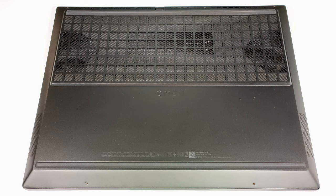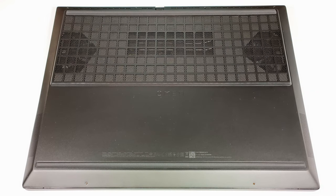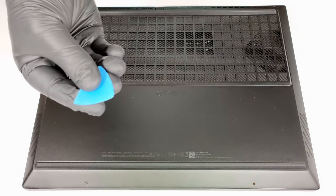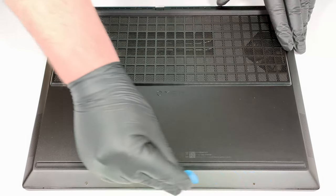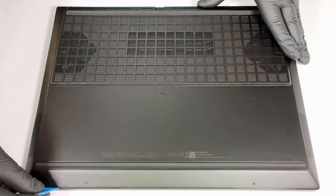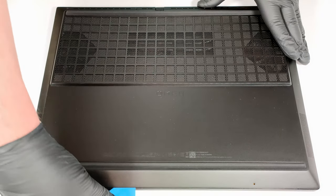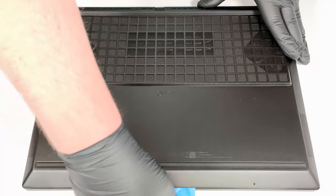To open this notebook, you have to undo just six Phillips-head screws. After that, slightly raise the panel with a thin pry tool. Don't push with the tool in a vertical position — place it horizontally in between the base and the plate, and fully pop the panel until all internal clips are fully released. You can start from the back or the front.